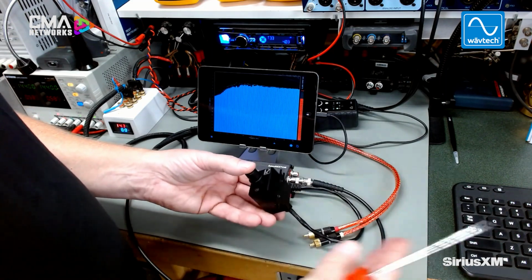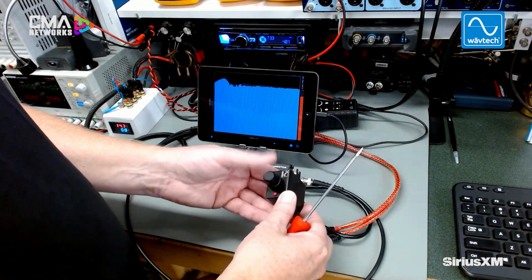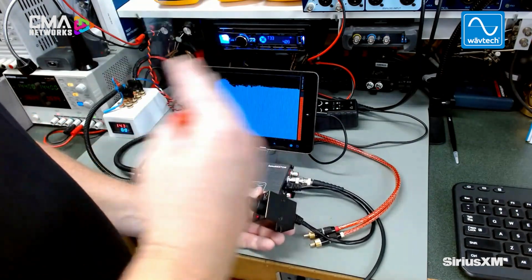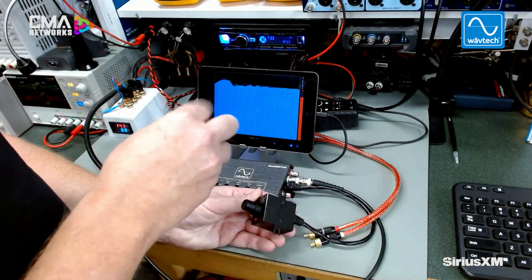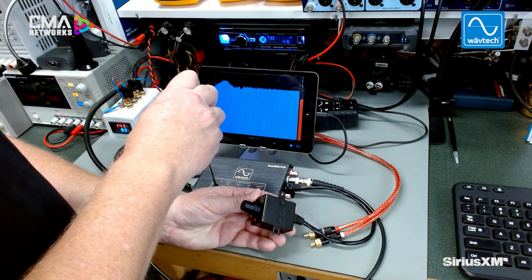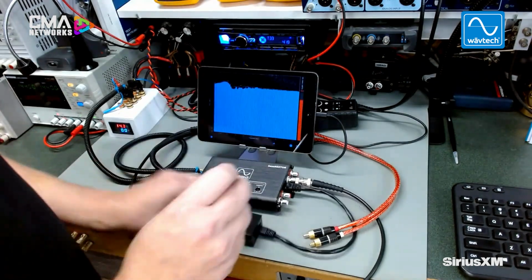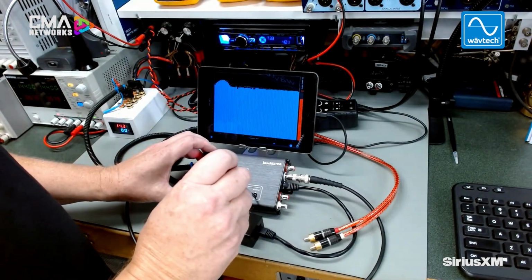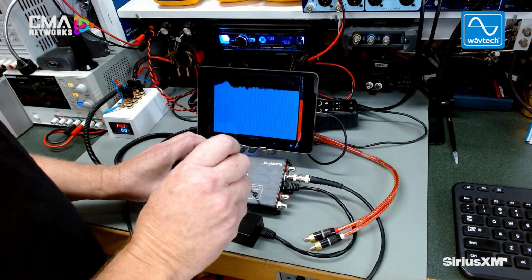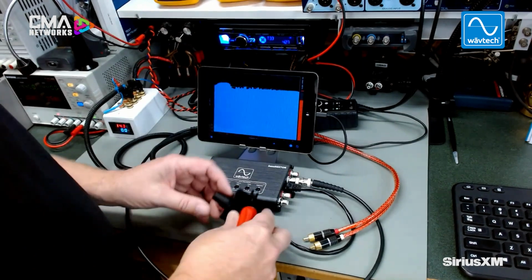Now, when you listen to music where you want it augmented, or you want it augmented all the time, when you turn that on, that's going to boost a lot of that low bass frequency. So you're going to want to go back and readjust your gain to prevent your amplifier from being overdriven or your sound from being distorted. You may also want to increase the cutoff frequency of your subsonic, to protect your subwoofer from over excursion once you've added in all that bass.